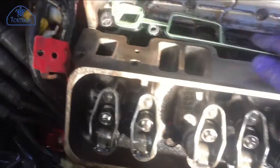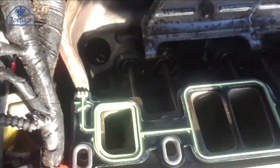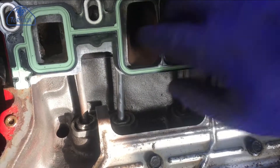After completing the valve preload adjustment, I can now fit the new intake manifold gaskets. These are fitted dry without the use of sealant. They also have a pair of small retaining lugs on the underside to hold them in position when the manifold is lowered onto them.